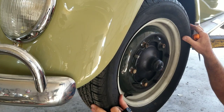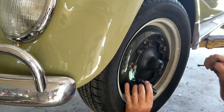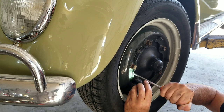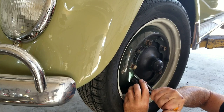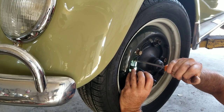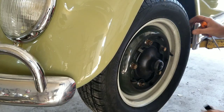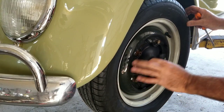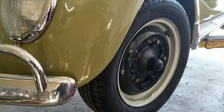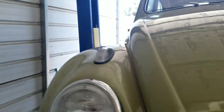I've noticed this one is still tight at one click, so I'm going to do two clicks on both adjusters. I go to two clicks and it's free now. I take the top one to another click so they're both the same and there's no resistance to the wheel. Sometimes the drum will be hitting just a little bit — that's okay, it'll wear off quickly. You want your brakes pretty tight. Then I do all four wheels the same way.